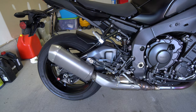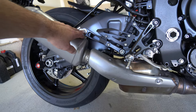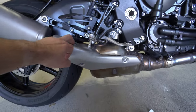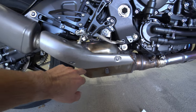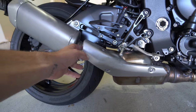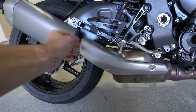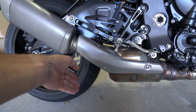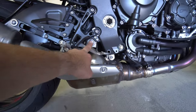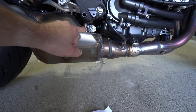There are a few things we need to take off. First, remove the stock silencer — there's a screw here and another one down here. The heat shield has three screws on it that definitely have to come off. There's also the exhaust hanger right there, and I think there might be another one on the other side or just a little lower down — yes, there's another hanger down here that we have to get taken off.